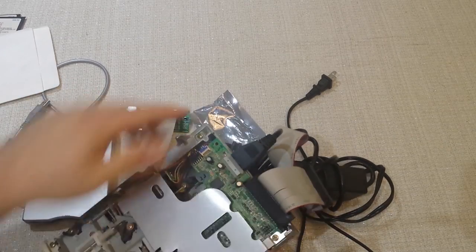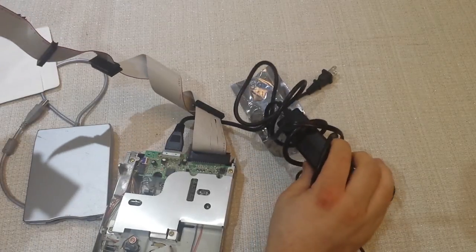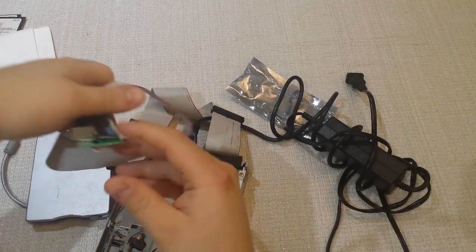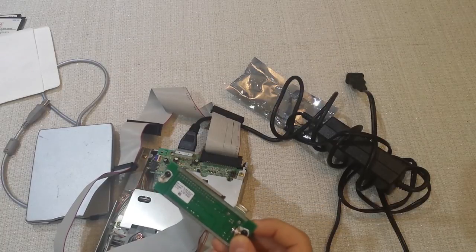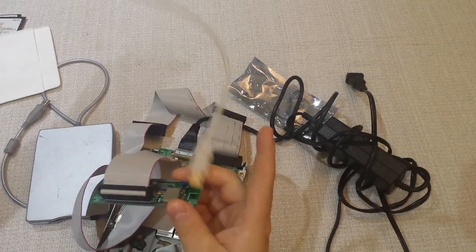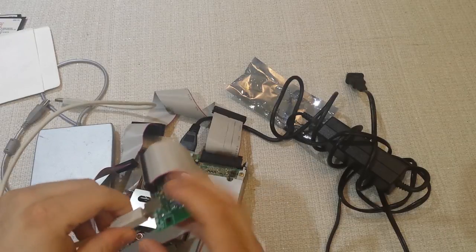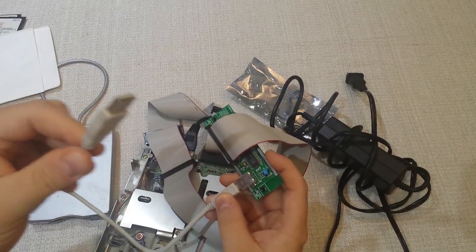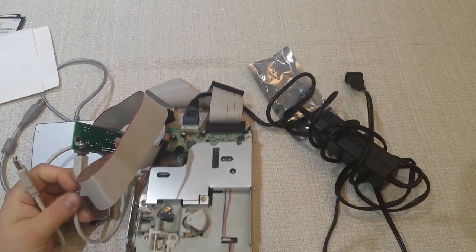So now I have: a floppy drive with a disk inside, a power cable which is going to be plugged into the wall, and a floppy drive cable — the other end plugged into this controller. Then I need the last piece: a USB cable, which I think even comes with it, but you can also get these easily. This plugs into the controller on one side, and the other end plugs into your PC. It's admittedly not a very elegant solution.